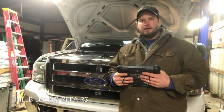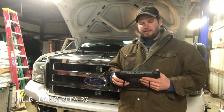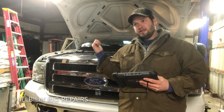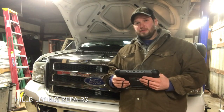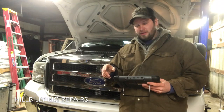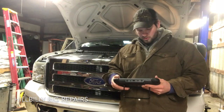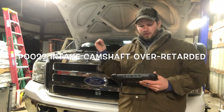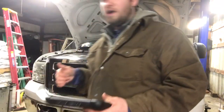What's happening YouTube. I'm going to walk you through my diagnostic process for this Ford. It's got the 5.4 three-valve variable valve timing engine. The DTCs — the diagnostic trouble codes — are P0022 and it could also be a P0012.